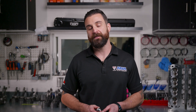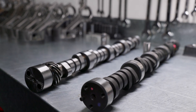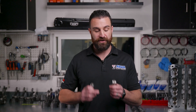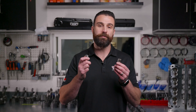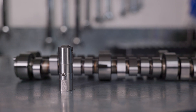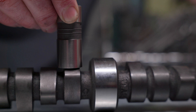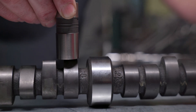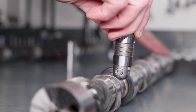The main difference between the two camshafts is the design of the lifter itself and the profile of the cam. With a flat tappet camshaft you have a flat tappet or lifter; with a roller camshaft you have a roller wheel on the tappet or lifter. You can almost compare it to a trailer being towed behind your truck where you remove the wheels and put water skis in their place. A flat surface riding on another flat surface is more prone to wear, whereas with a roller camshaft you have a roller wheel on another roller surface — a lot less wear and surface friction.